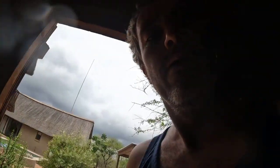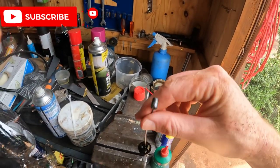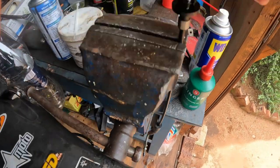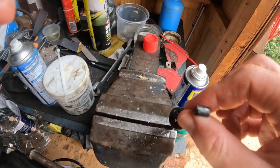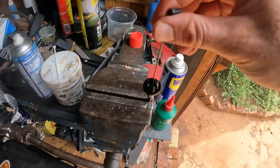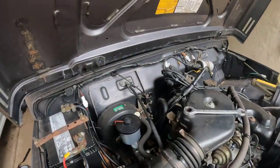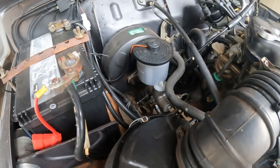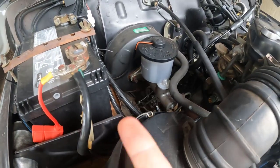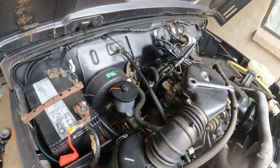Much better. Now we're going to lube it with some all-purpose oil — it's already coming out at the bottom. Just a drop or two, then wipe it all down and put it back in. Now that everything's clean, the trick is going to be locating the hole for the throttle cable because it's under the brake booster. I'm not going to be able to film that, but I'm going to feel and stick that cable through there, clip it back in, and then film the top bit where I set the tension.